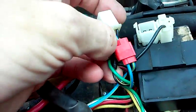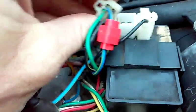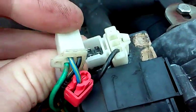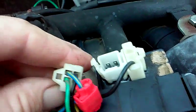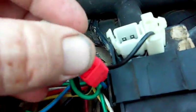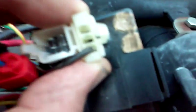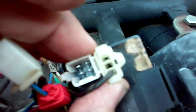On this particular system, your trigger wire is blue and white, and looking at this plug, that's the top left prong. Right directly underneath that would be green — so that's your bottom left. Your coil on this one is the top right prong inside that plug. This one's 12 volts. There may be another wire in there if someone's messed with the wiring — I think this one here is a kill switch, but you'll want to double check.